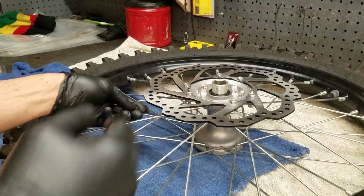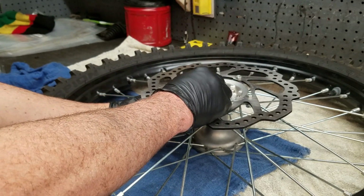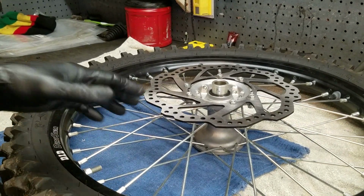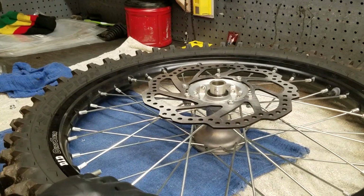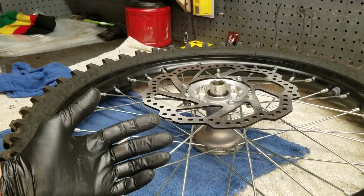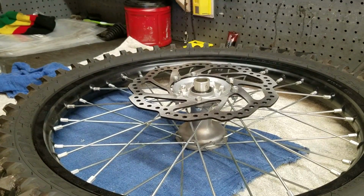is leaking. 3 heat cycles on the stand, but on the first ride, it's going to be the same thing. Make it a shorter ride, 8 to 10 minutes. When it's a full bottom end like that, or a full motor rebuild, I would say just don't do any full throttle on the first ride. Really, just don't do any. If you ride mainly tracks, you can ride around the pit of the track, or take it to a field or somewhere around your house where you can just do a 8 to 10 minute ride, kind of easy. You just want to cruise it around.